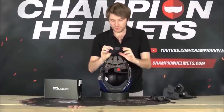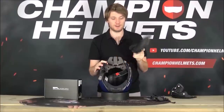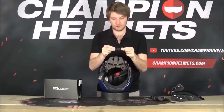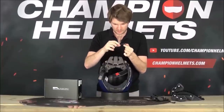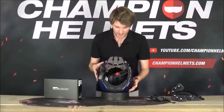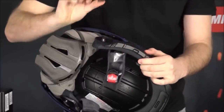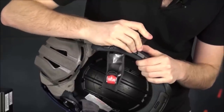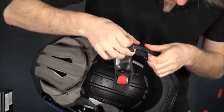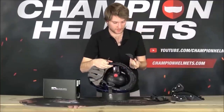Don't lose any of this stuff, by the way. These we're not going to use until you take the Sena system out, but these are going to have to go straight back in, so definitely don't lose these. For the installation as well, you're going to need this little tool that Shoei gives you - it's supplied by Shoei in the box and comes in a little plastic sleeve. We're going to need this to take off these covers here. What we're going to do is put it in here where there's a little clip, and it's a lot easier with the tool. We just press it out and it's going to come loose like that, and it's come all the way out. Also don't lose that.